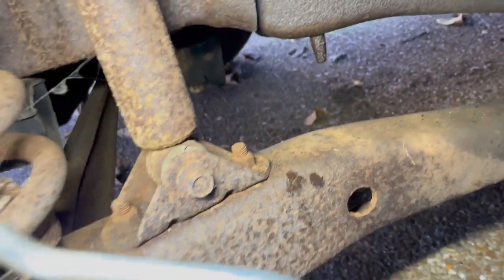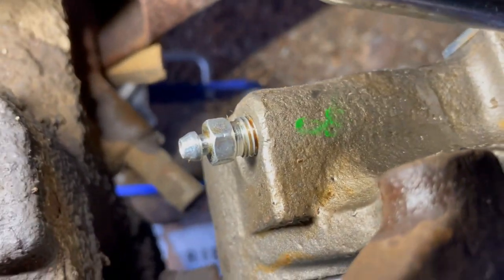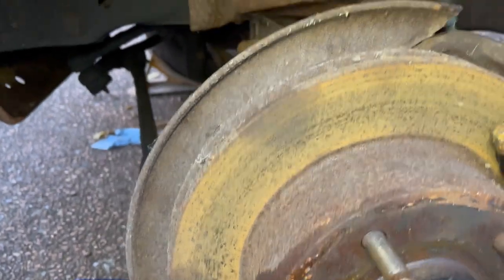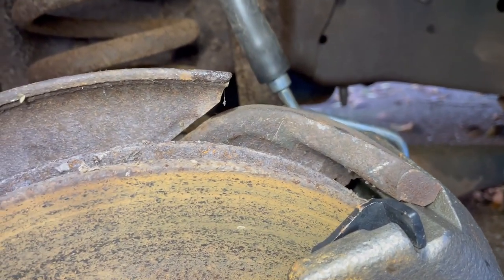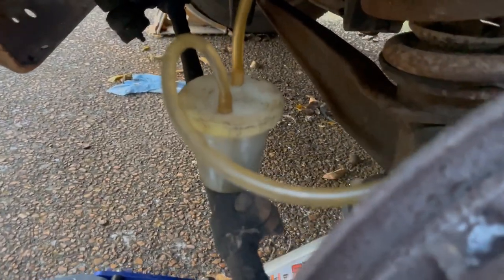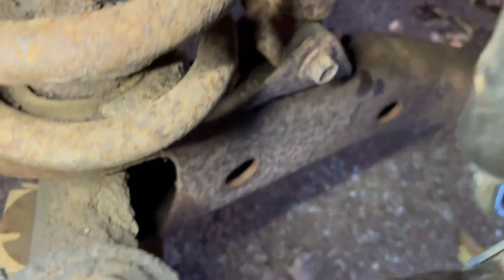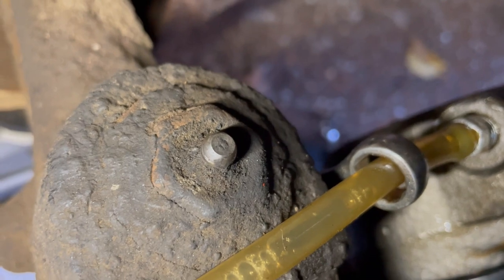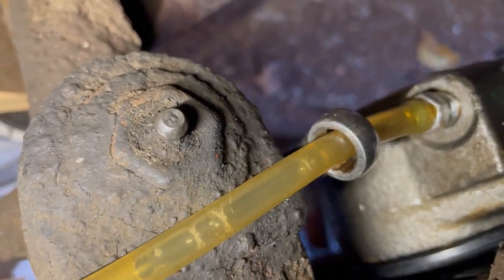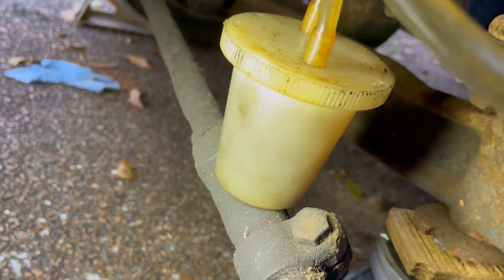This side is done. I'm going to try to get some pressure and bleed the lines - there's the bleeder right there. Being manual brakes it's pretty easy to bleed them - you just hook up the one-man bleeder and press away; you don't even need the engine running. The one-man bleeder is hooked up on the bleeder valve. I opened it with the wrench, pumped a bunch of times, and checked the master cylinder. It was about a third full when I started - now it's full, so we're pumping really good.